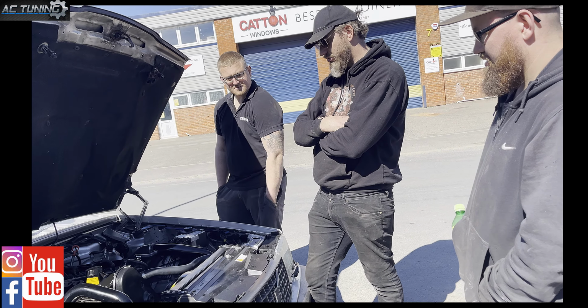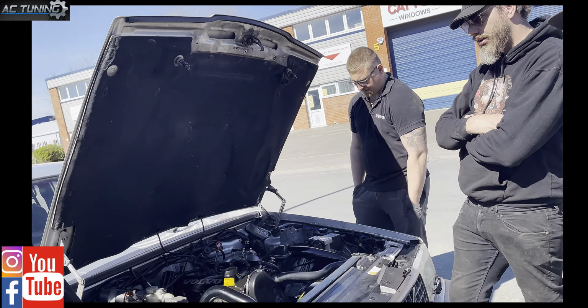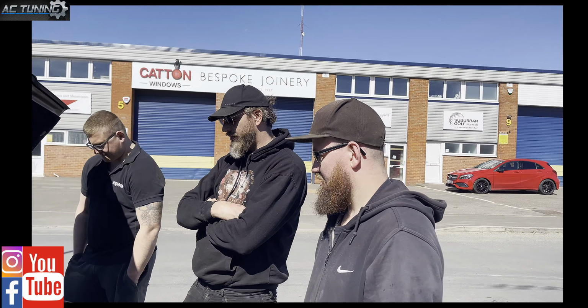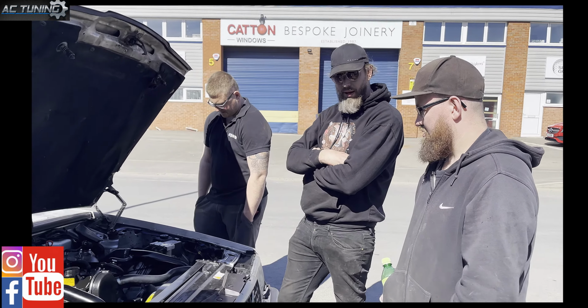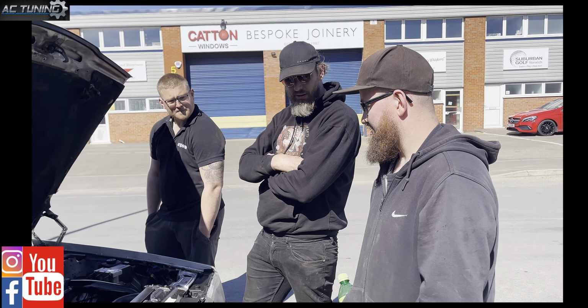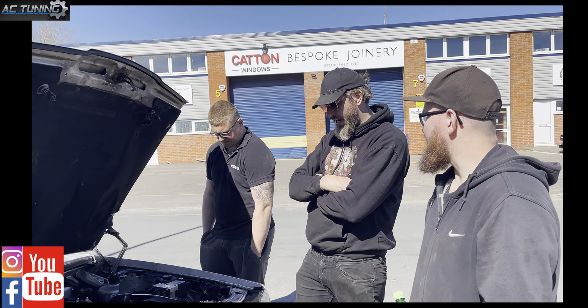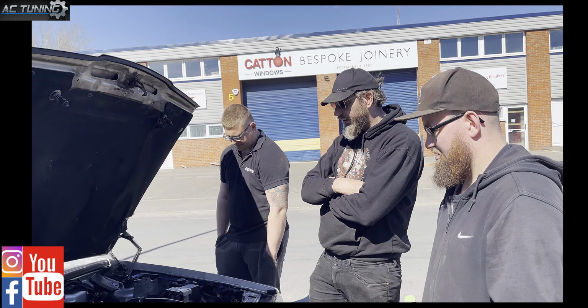It's just really simple stuff to make them work well, really. Yeah, nice. Most of it's bolt-on stuff. Cam in them makes a big difference, being a kind of 8-valve. Yeah. What sort of profile is it? I don't know what that one is. It's 270, isn't it? Sounds about right. I think it's 272, and it's 11-ish mil of lift, I think.